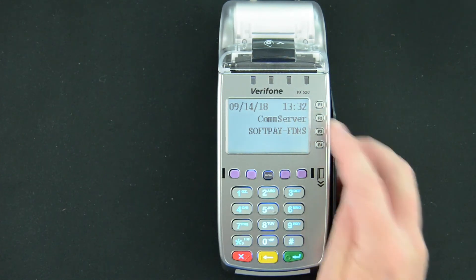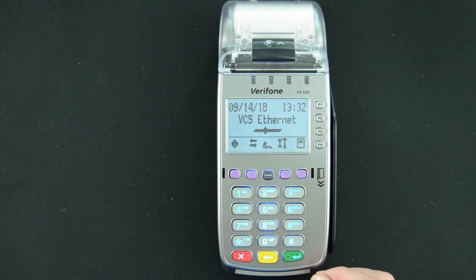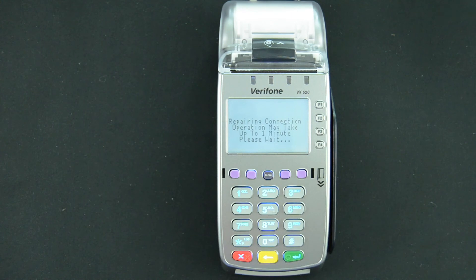Now, if you're getting errors on various things earlier on, you can go back under CommServer, back under the tools icon, and you can use the repair option. This is basically just going to drop the IP address information that's already in the device, especially if it's dynamic, and re-request that information from the DHCP server on your network. You'll go ahead and just press enter when it says successful, and then go right back into the troubleshoot and see if anything has changed.